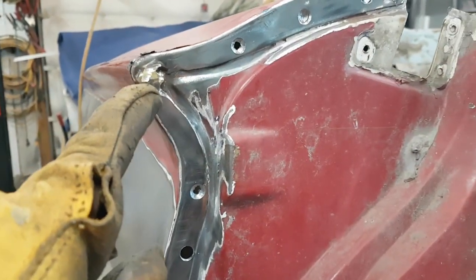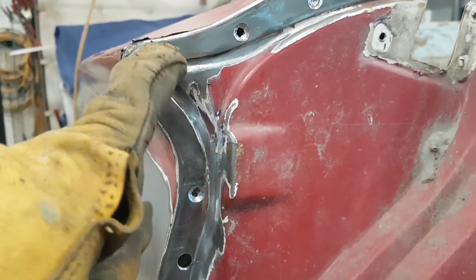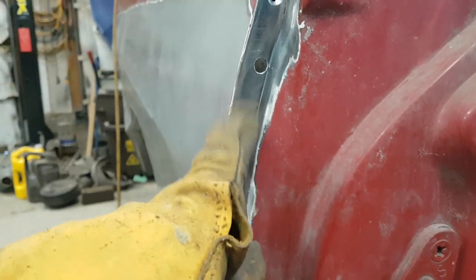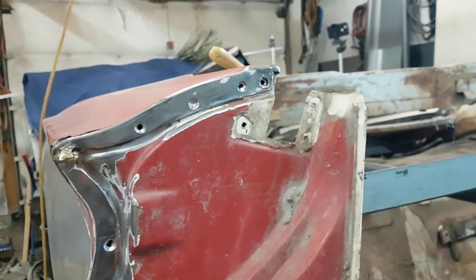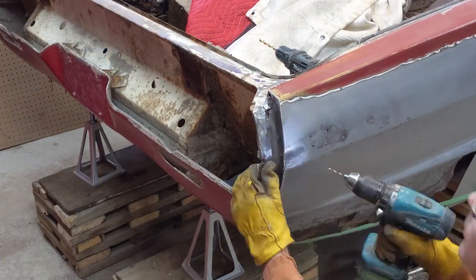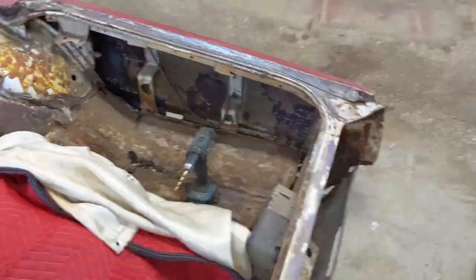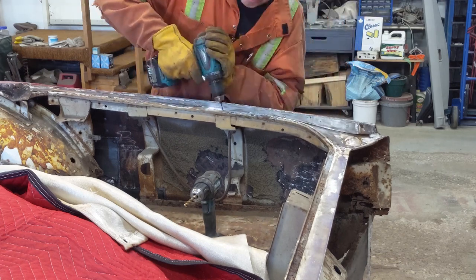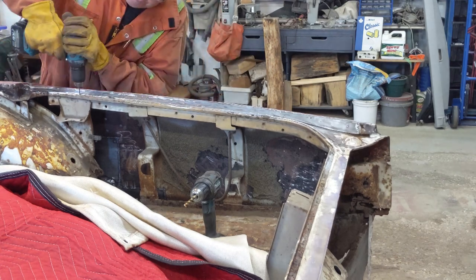I just want to point out that it's brazed right here as well. So if you're doing this work, just a note that it is brazed at that corner - it's not leaded or anything, it's just a braze. Going to have some touch-up to do on this door jamb once I get that. That does plug weld all those holes - that's not a big deal. Good indexing holes to put the quarter panel back on.